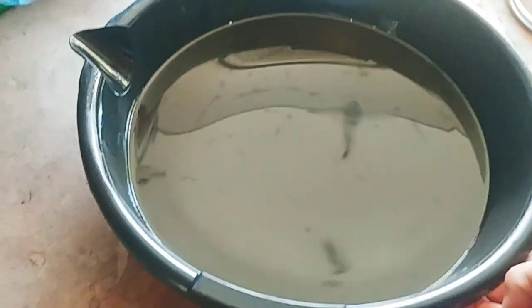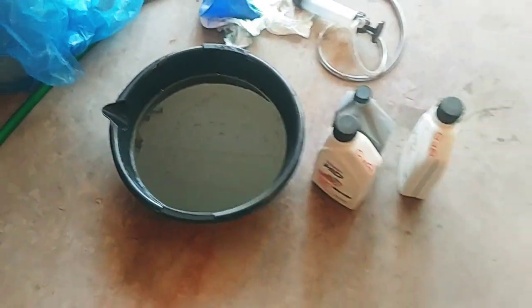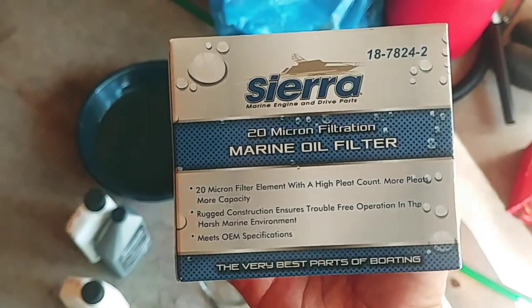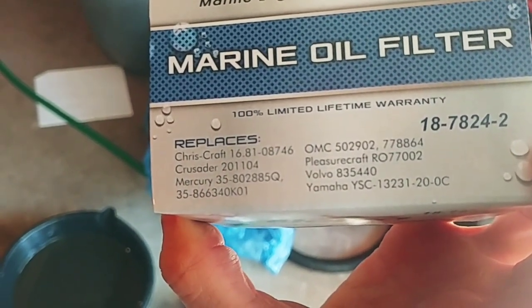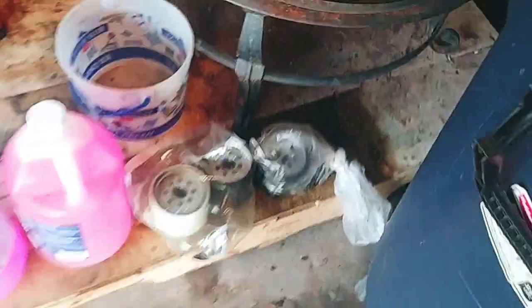I probably got about two quarts, and there's probably another two quarts in here, so I need to put new oil in the engine. Two of these containers were half full, so I can eyeball it and know I got almost four quarts out. I'm going to do the filter now. This is the one that fits — it says right on the box it replaces part number 35866340K01. That's the one we need, and I can verify it over here. It's that K01.